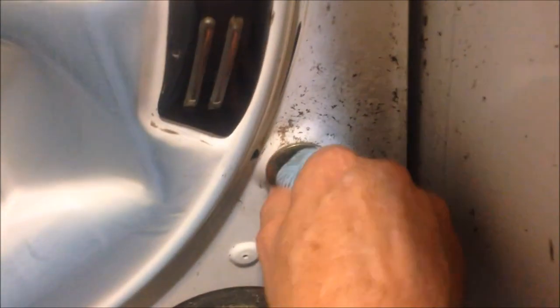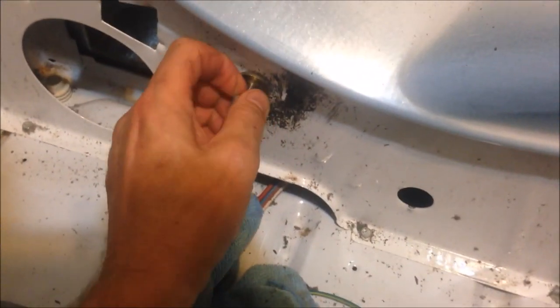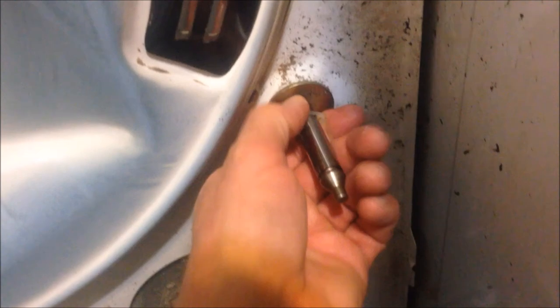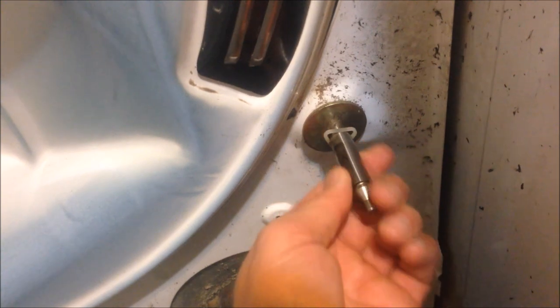We've used just a soapy rag and wiped this stuff off. It doesn't have to be real clean — I mean, this is the inside of a dryer, this is the mechanical part of it. The main thing is to get these shafts clean. Your kit comes with four of these triangular fasteners, so you want to remove all of them. There's one on the back, then you've got the wheel, then one holds the wheel on — so remove all of these on both shafts. Make sure your shaft doesn't have any gouges in it or worn in such a way that it would ruin the wheel. These are in good shape.